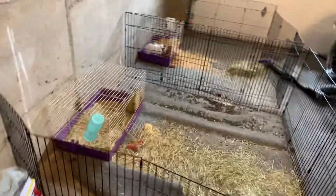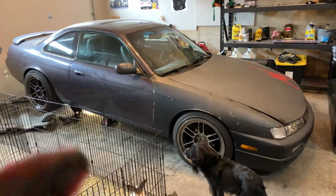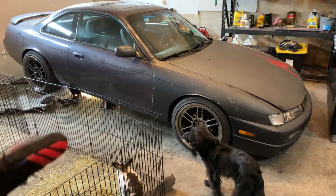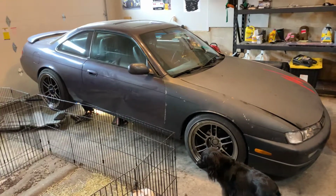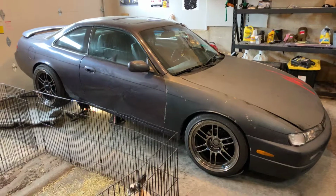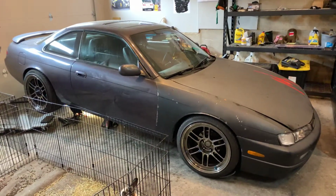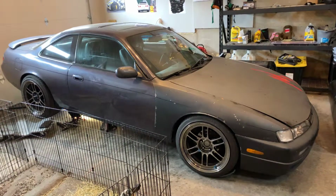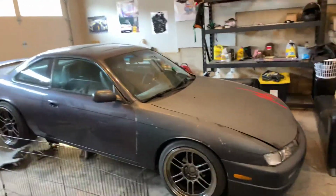So I actually think, now that I remember, I might as well put it in this video. I'm planning on doing the bodywork, the prep, and the paint job myself. I'm gonna buy a half-decent paint gun and urethane. I'm gonna try to do a single-stage urethane, and I'm also gonna clear over it, as long as the clear is compatible with the single-stage urethane. I'm gonna do a pure white, the whitest white I can find. So yeah, I think it should look good.